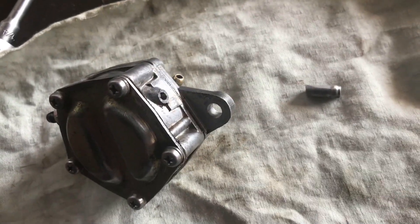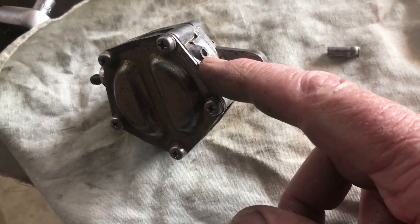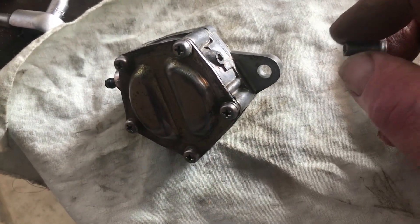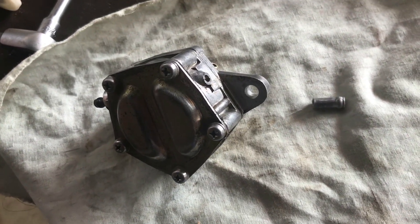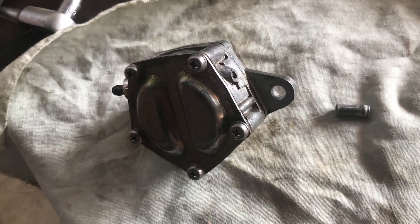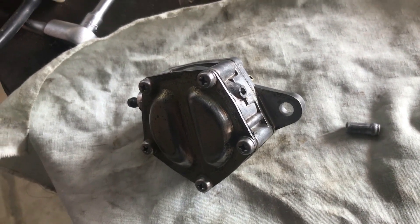That sets me back a little bit in time. At least what I'm going to do is drill through here and tap it - maybe M6. I've even got an M7 tap and die I believe, depending on what diameter it is. I'll turn up a new brass piece, now that my lathe's working, to screw in there, and then I might Loctite it in to try and fix this rather than just dispose of the petrol pump. I actually do have a spare, tested on a previous video - it's a bit rusty, it came off the '88 bike, but I think it works. If this doesn't work I've got something to fall back on. This is a nicer looking pump if it works and I don't want to just chuck it away.